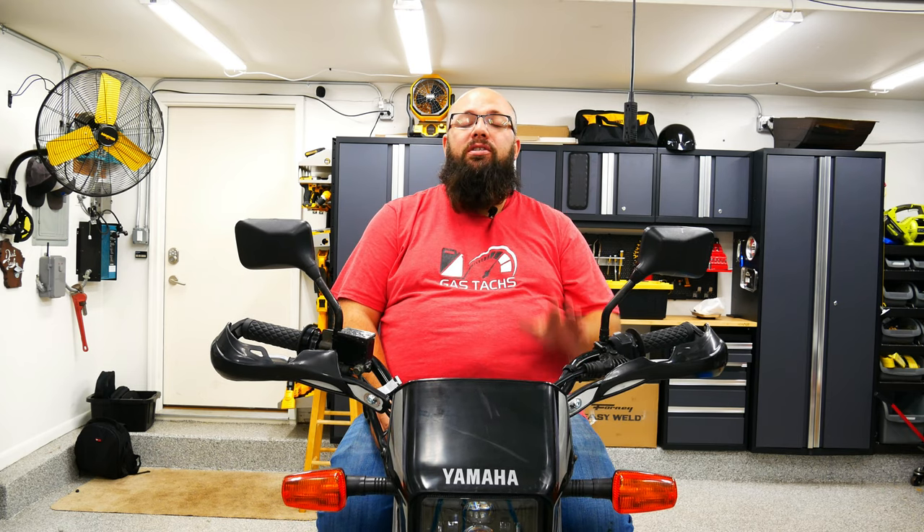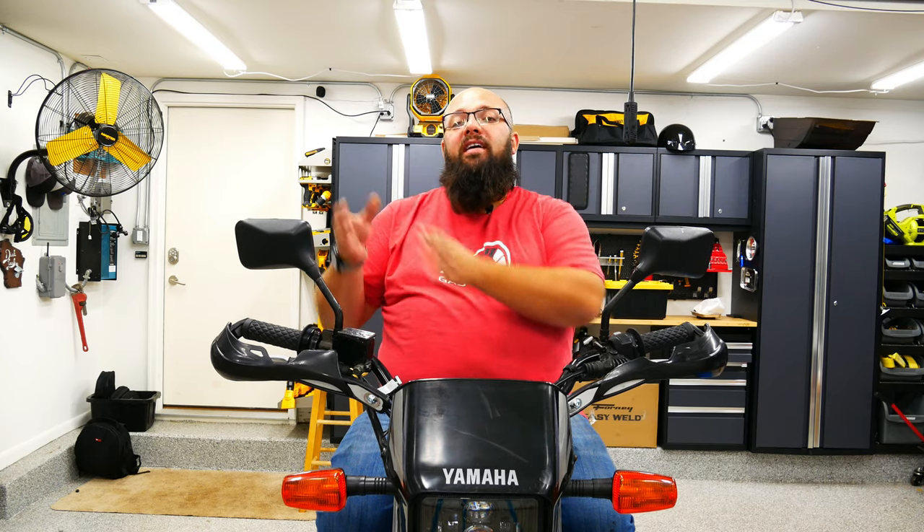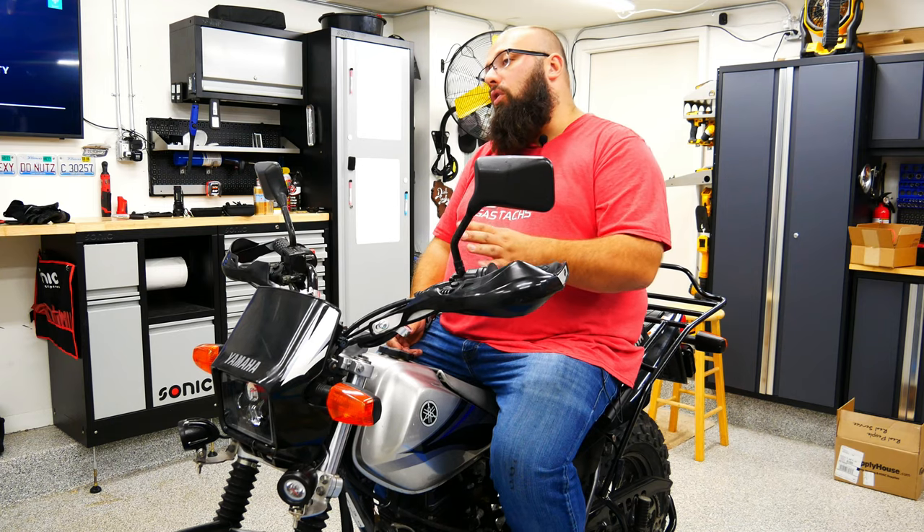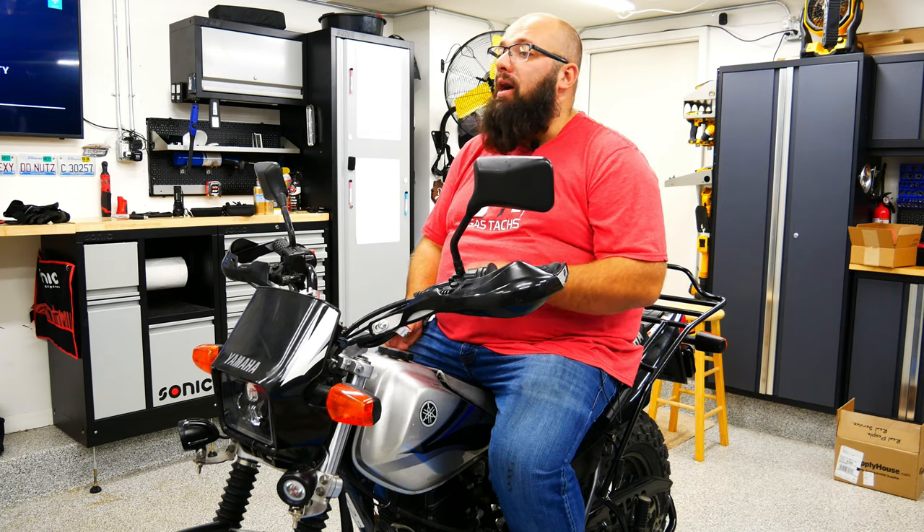I put about 70 miles on the bike and decided to change one or two things. Firstly, I have a 14/50 sprocket set — that is stock. You change gears every 7 miles per hour with that stock combo. Luckily this bike came with a 47-tooth in the rear, and I kept the 14 up front but changed that out. The bike rides much better now. Secondly, the rear spring — I'm a heavy guy, I weigh 280 pounds, and I went with the heaviest spring you could get. I kind of regret that. The ride is like riding a brick.